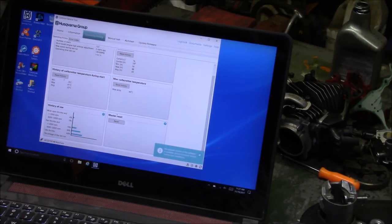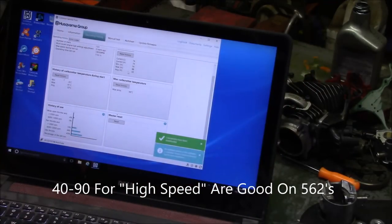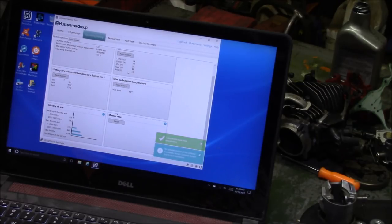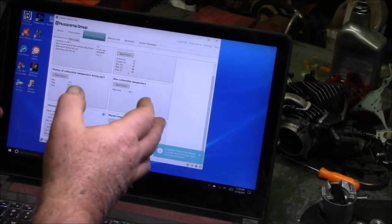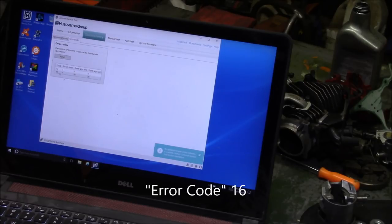The last carburetor settings: 74 for low, 79 for high. When you get numbers in the range of around 80, these are good solid numbers. What that gives me as a clue — it's not a big billboard — but it tells me there are no air leaks, otherwise those numbers would be a lot lower. Also, it has healthy compression because the numbers aren't trying to lean out to pick up RPMs where they shouldn't. It had error codes 16 and 13 — 30 starts ago — and that doesn't really bother me either. Let's go see what a 16 is.